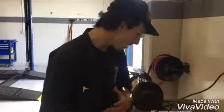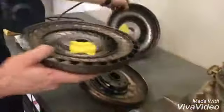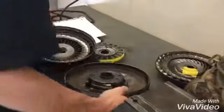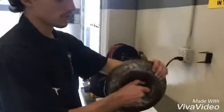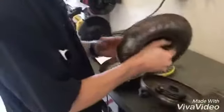There are about three phases when talking about an automatic transmission. The first is the stall phase — you're just sitting at a light with your foot on the brake. The impeller is rotating but the turbine is stationary. The fluid is being thrown but there's not enough energy to overcome the resistance of your foot being on the brakes, so the turbine is not going to turn.